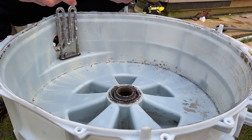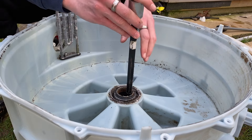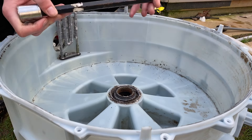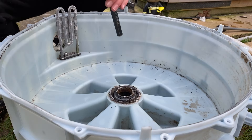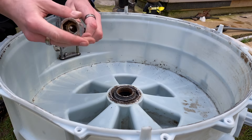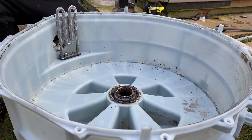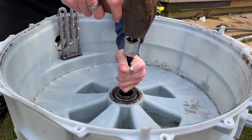So for tools you want one of these - call it a rod - that's what I've got, a metal rod, and I just shove my socket onto the end like that. I normally put the big end onto the big bearing, but when I do the small one I don't really need that much power so I just put this end onto the little bearing and work my way around evenly so it makes it easier to come out. The socket gives a bit more surface for the hammer to hit onto.